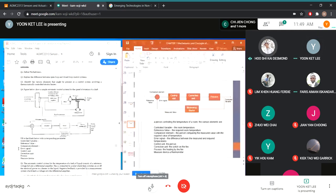Yes. Not sure, sir. Yeah, I understand, because for us, we cannot know actually what the system is inside, but in general, we roughly know that in order for the aircon to be automatic, there must be some sort of microprocessor or CPU or PLC type of controller. So you can give me generic terms, I will accept. So the microprocessor will be the control unit, because all your program will be stored in the microprocessor, and it will do the action based on the information received from the outside. Just like the washing machine I showed you.